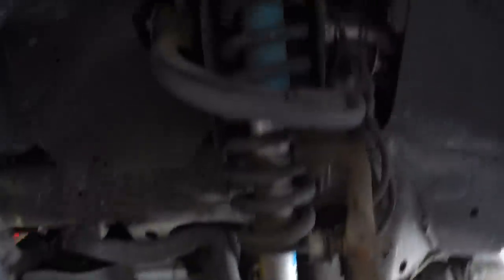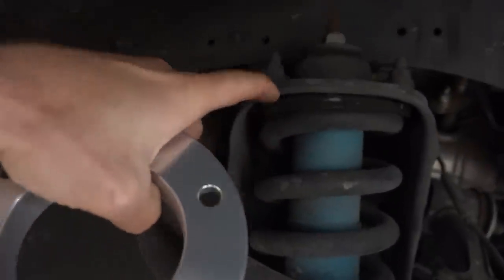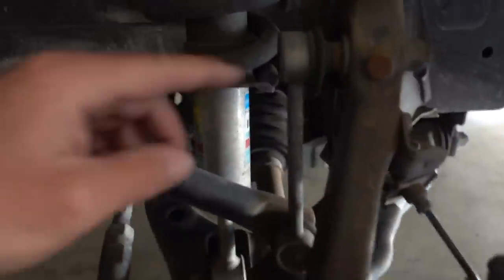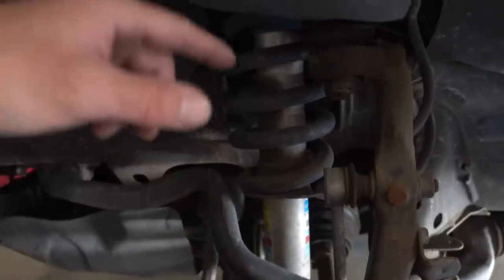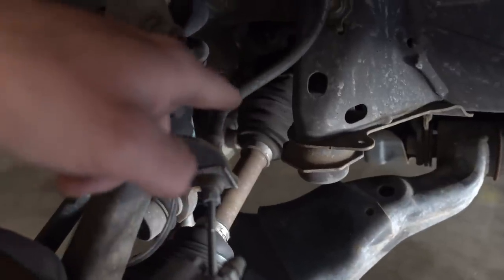Got the wheels off in a very tight spot, but I think I have enough room to work on all this. What I'm doing today is putting on a leveling kit. For those of you who don't know what a leveling kit is, it's basically just a couple of spacers that go on top of the spring perch. So this is going to come down, I'll pop this spacer in, bolt it to that, and then these become the new bolts for the top. That's just a little spacer to give it a little bit more ground clearance and room for those new Falcon tires. First thing we have to do is take off the sway bar — I'm going to pop that off just to release the tension, do that on both sides. Then we'll proceed into dropping this shock down. The tricky part is we don't want to drop it too far to where you pull the CV boot out — if we pull that out, we've got a major problem. So I'll support that with the jack and we'll do one side at a time.